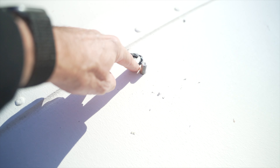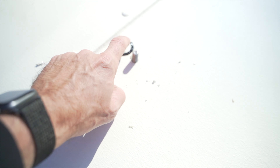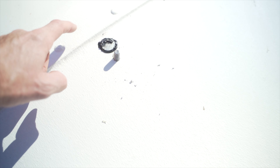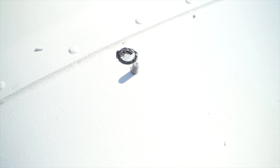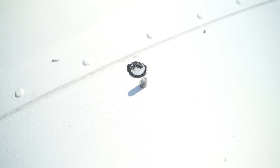Here's an example of the bolt head up and through. And here's an example of a mistake that I made — I accidentally ran my drill bit a little too close to the part underneath. This is square tube, but this is where the fiberglass shell and the roof join, and I definitely came a little too far this way. Got that sealed with some Sikaflex, and then I'll have a piece that goes right over the top of that, which should keep it from being an issue. Anyway, I'm gonna get these bolts up and through and the rails on and ready to go.